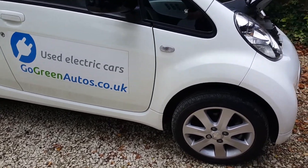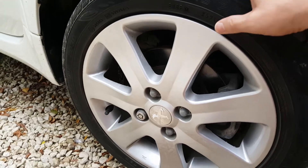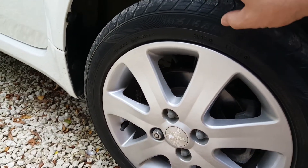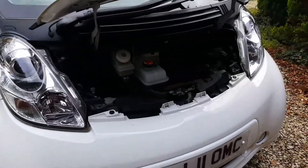The maintenance on these is very simple — very little needs doing on them. You've got your standard checks that your MOT test does: brakes, tyres, shock absorbers, suspension joints, headlights, wipers — all your standard safety checks. Obviously that needs to be done every year.